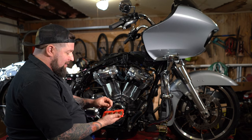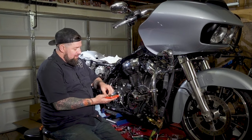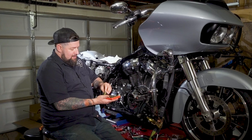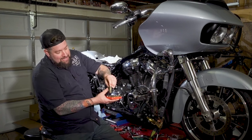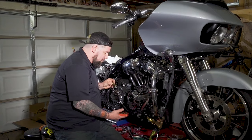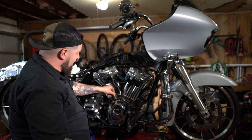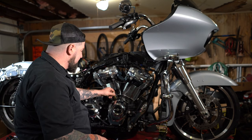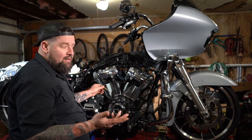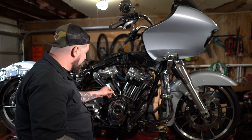Our lifters are all bled out. We got a handy little lifter tray here, so we'll set that down. And then we're gonna lower each one of these lifters down into the port. Now there is a wee tiny little hole right there. And if you look down inside your lifter, you should see a hole inside there as well. Now, that's considered good procedure, but honestly, if it's pointed the wrong way, the oil will still get around there and still fill it up.